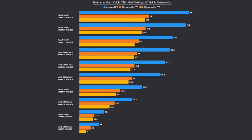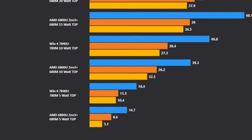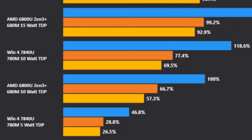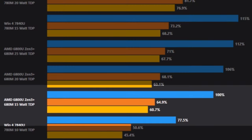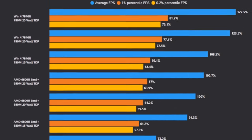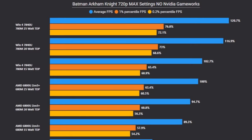Let's take a deeper dive at the 7840U's performance and how GPD seems to be making the best 7840U devices. The focus here is just to briefly get you up to date — I've done far more in-depth reviews previously. We're looking at the GPD Win 4 7840U across different TDP slices. The game is Batman Arkham Knight at 720p max settings, no NVIDIA GameWorks. At 5W the 7840U is around 25% better than 6800U. At 10W it's around 19% better. At 15W about 15% better. At 20W around 24% better.